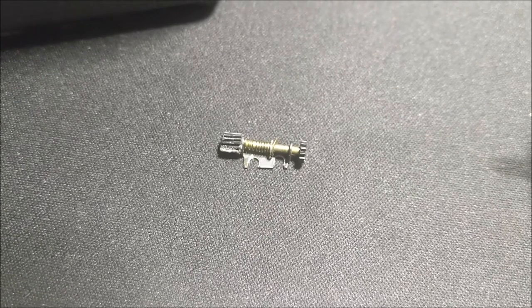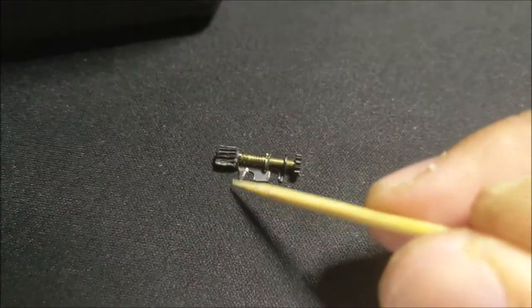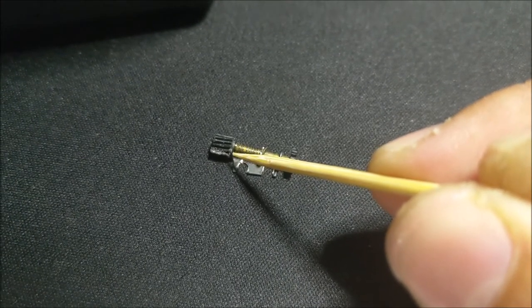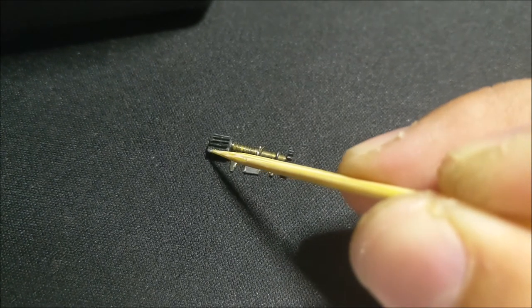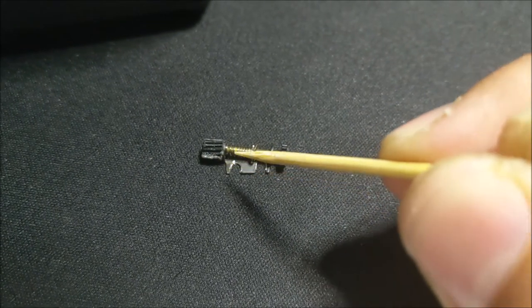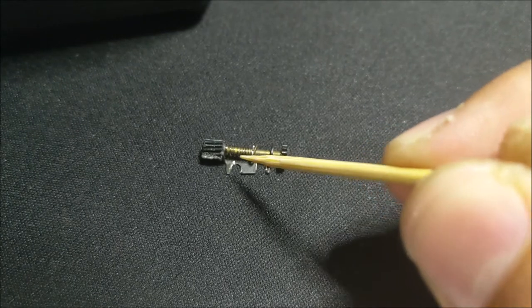Here's the one main flaw: the counter gear. You can see how over time it had split open. I simply used Gorilla Glue or Crazy Glue, placing some in here on the shaft so that it stays. You're also going to want to check that it's not stuck to the spring as well.